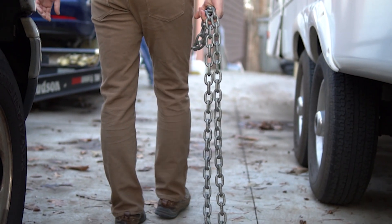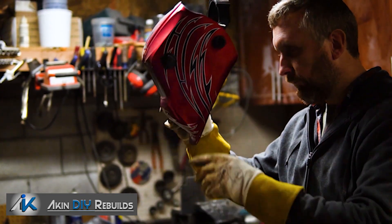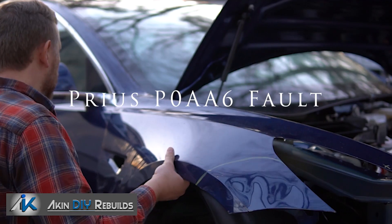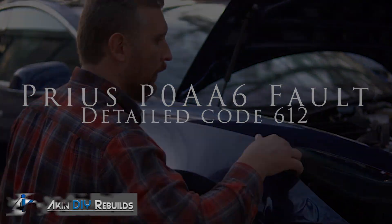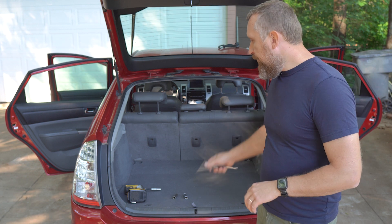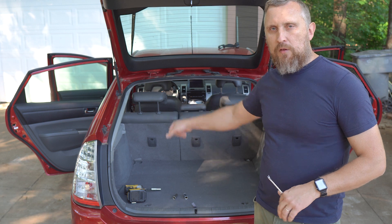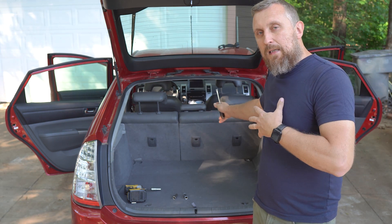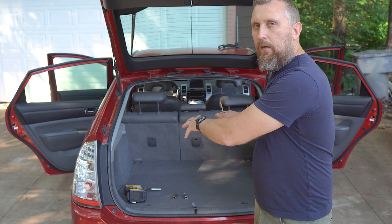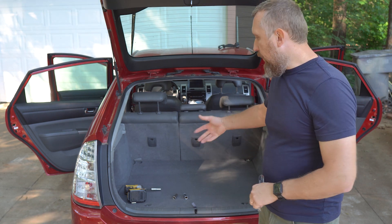Here's the plan. The first thing you should do is disconnect the auxiliary battery and then disconnect the orange plug from the high voltage battery. I usually like to start with the seats first — take the seats out — and then start with the trunk area and remove all the panels and trays from the trunk.